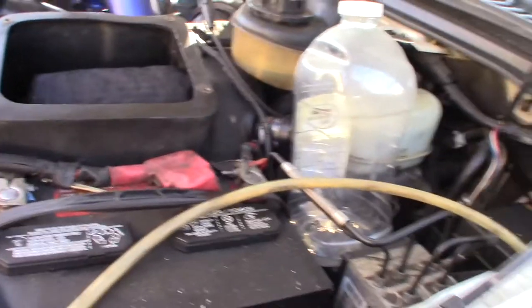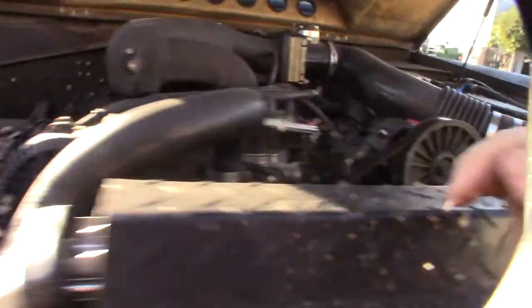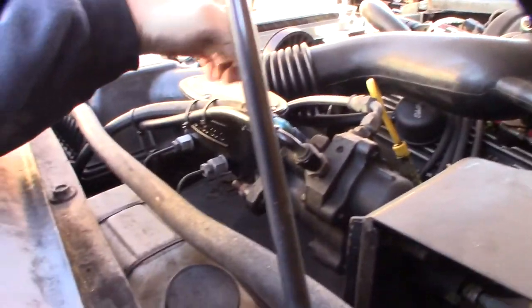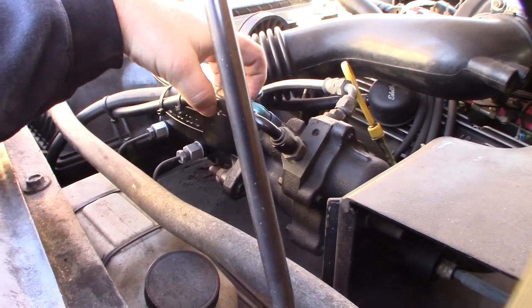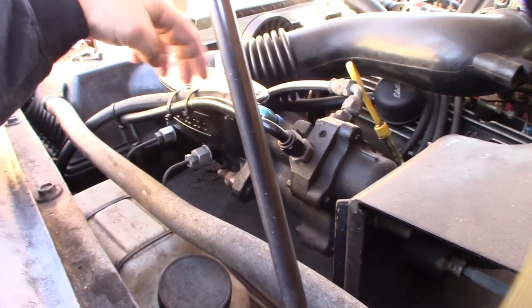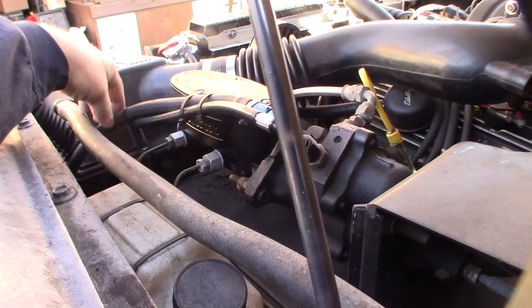You can't really see it in this engine, but I have a '66 Bronco right here with the exact same setup — power steering with hydro boost. I wanted to show how that works and why you connect it to this low pressure return right here. This is the last leg: the hydro boost unit. When doing a flush on one of these systems, the last leg is the hydro boost return, and that's where you connect your catch can.